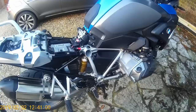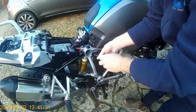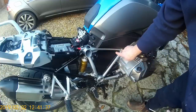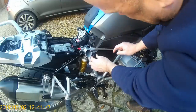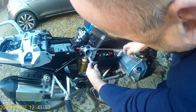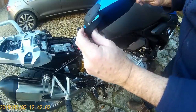First, remove the battery cover — that requires a Torx 25 screw. Be aware there's a pip on the cover that can get stiff; I've applied a little grease to the rubber there, which helps it come off freely. There's also a little peg at the bottom you have to clear so you don't snap anything off. There's a peg here and a push-fit with a Torx 25 screw.